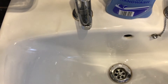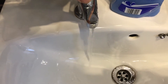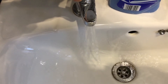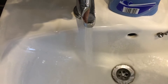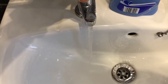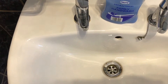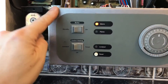To demonstrate now, the amount of pressure we need coming out of the tap to get the boiler going - there, it's just gone off. So it's got quite a flow but it's now definitely not going to fire and keep going while the tap's not running, which is what was happening before.